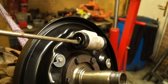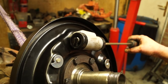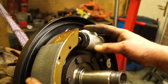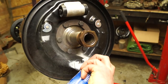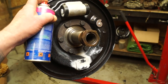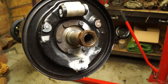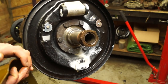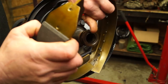Before you go ahead and fit your brake shoes, just make sure — if you've changed your wheel cylinder or had them apart — that they are actually in position so you can fit the shoes. There's nothing worse than getting to it and finding it won't fit. For lubrication I use a ceramic grease, which is dry and doesn't drip onto the brake shoes. It's basically heat-proof, and I'm applying it where you can see — at the bottom anchor plate especially, where it needs to move.